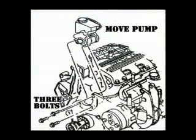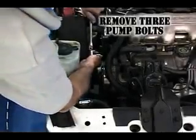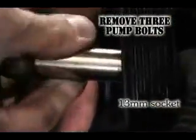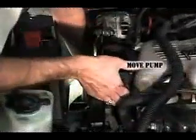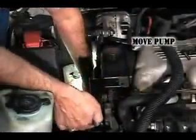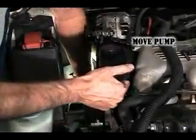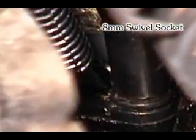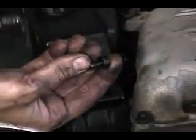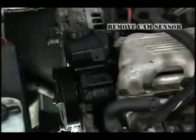Remove the pump mounting bolts through the access holes provided in the pulley and raise the pump a few inches to expose the camshaft sensor. The cam sensor is held down with 1 mounting bolt. Remove the bolt and with a screwdriver pry the cam sensor up. The sensor will pop as the sensor sealing O-ring releases.